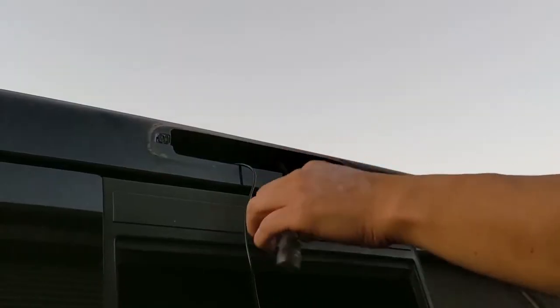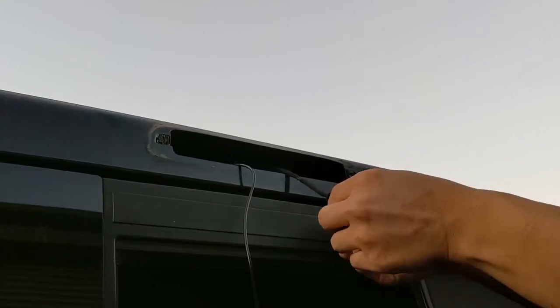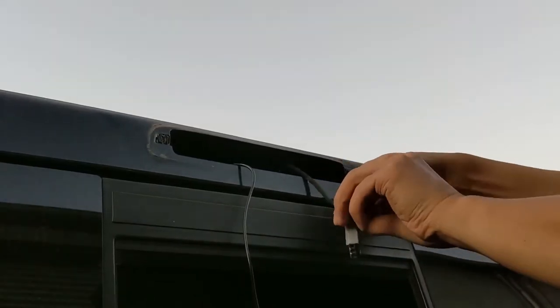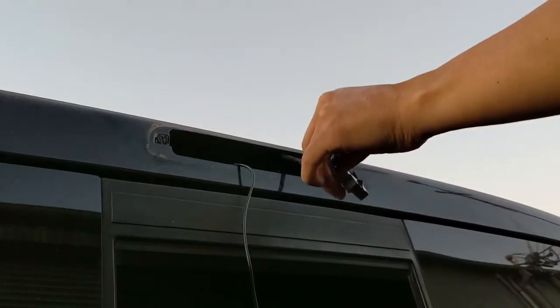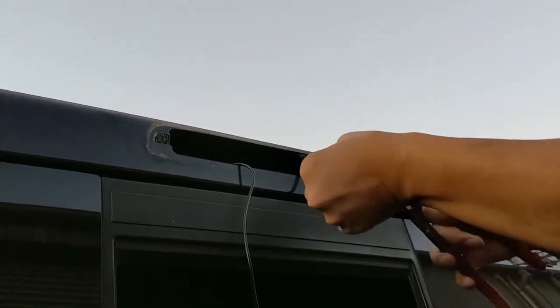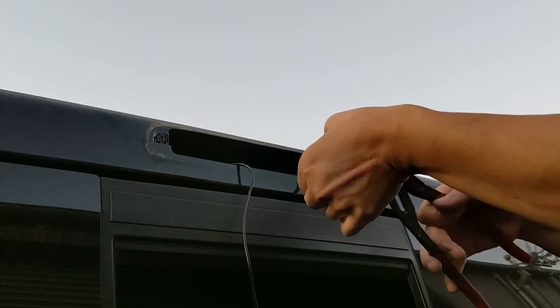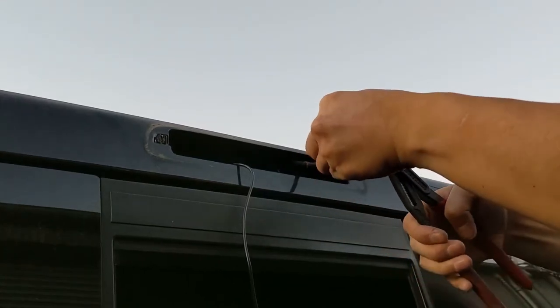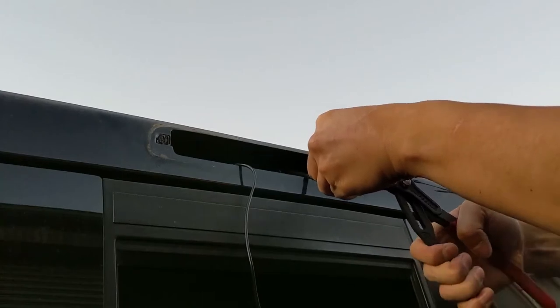Here I'm going to tap the ground on the brake light harness. I'm supplying power from my head unit to the backup camera, so I don't need to tap anything else here — your installation might be different. Again, because this is a prototype, I'm not too worried about the connectors, but I will eventually come back and solder the connections.